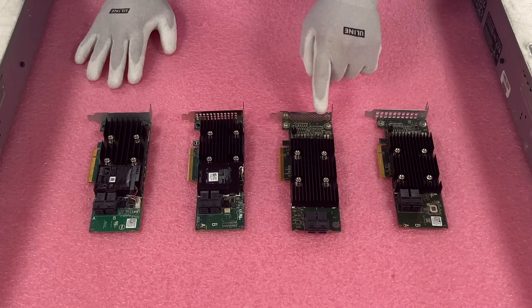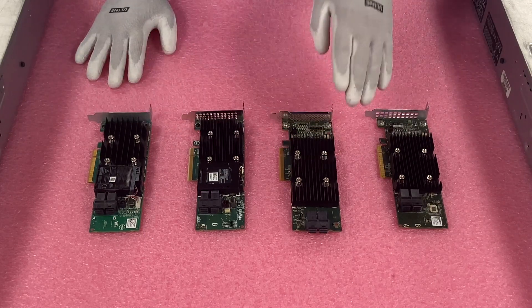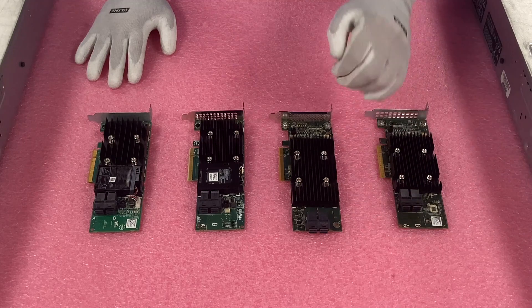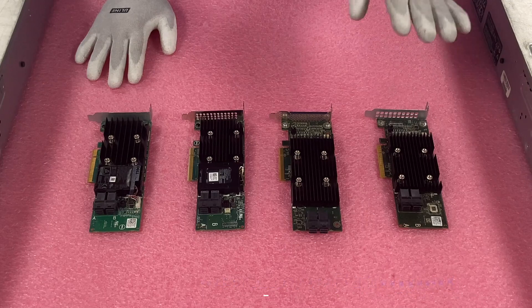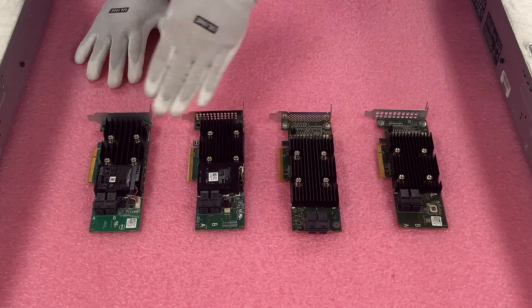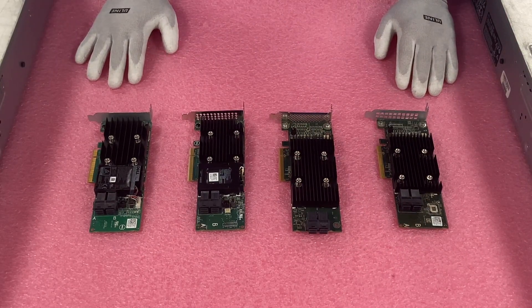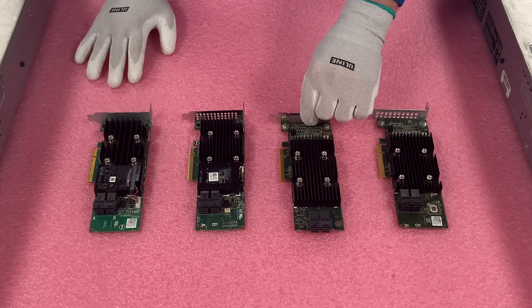One thing to note: this particular H-330 actually won't work. If you look at all the options, the big difference is the connector position — on the other cards the connectors are further back, but on this H-330 they're further up. There are other H-330s where the connector is moved back and those will work. The H-330 is supported, but this specific one would not fit because the dedicated PCIe RAID slot has limited room and you physically wouldn't be able to plug the cables in.